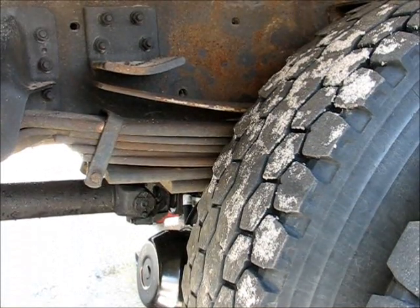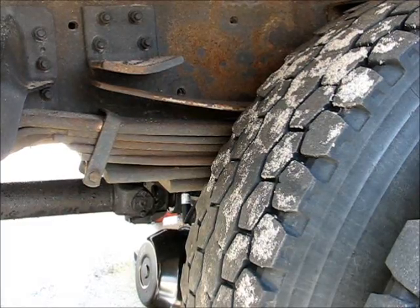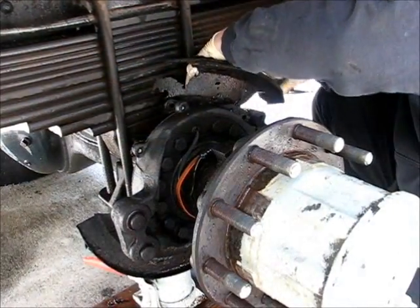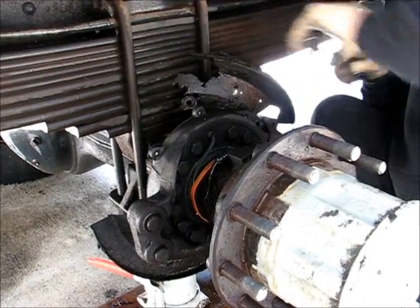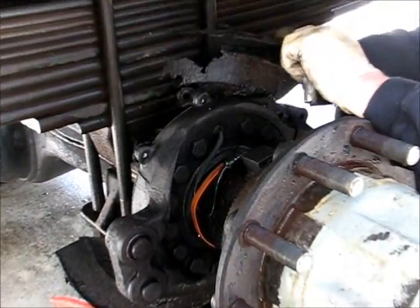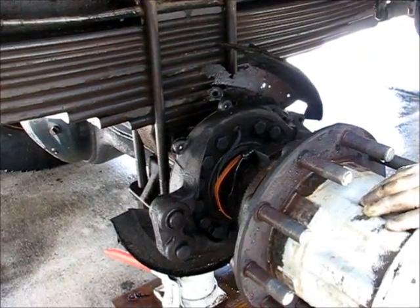On this side, we found actually a leaf spring that has three multiple cracks that will go to a spring shop in the next few days. On this case, we have to get a smaller socket due to the length of the socket to the spring housing. So I shall be back.